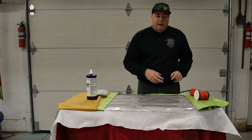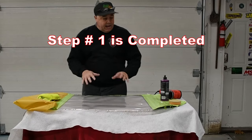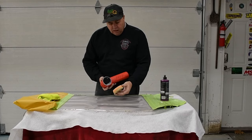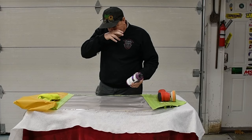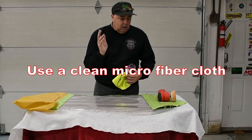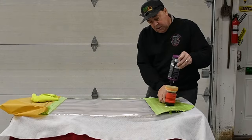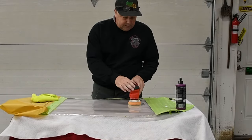I'm going to do the entire interior inside of the glass with step number one, then come back and do the whole glass with step number two. So now I have the entire interior inside of the glass — this half anyway — done with step number one. I'm switching to step number two: an orange foam buffing pad from Gryot's on the same buffer, using 3M's number two compound. Make sure that number one has been completely removed, change rags, change pads from microfiber to foam, and apply number two compound with a fresh rag.